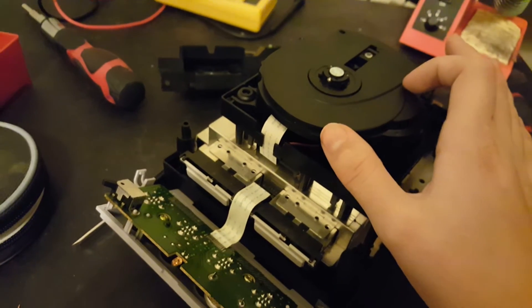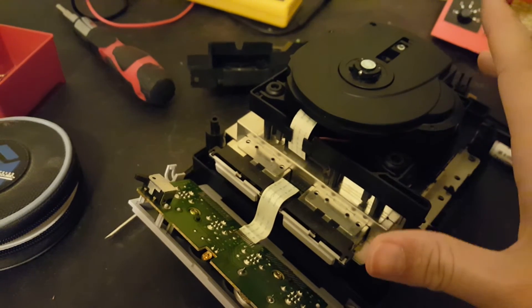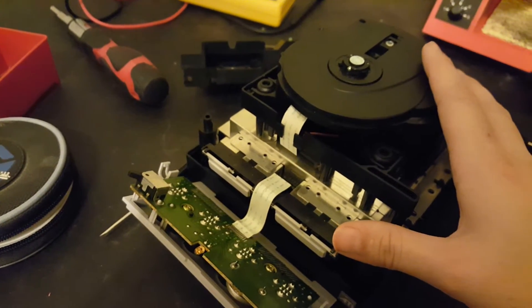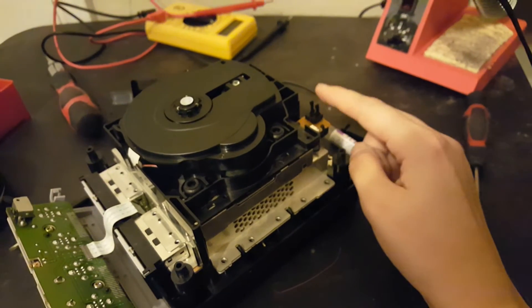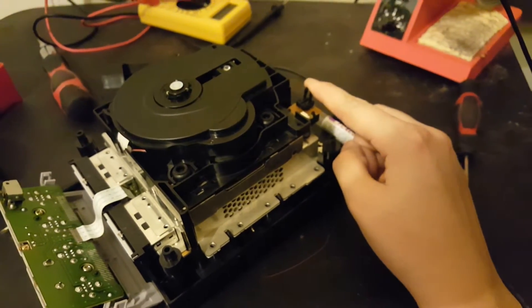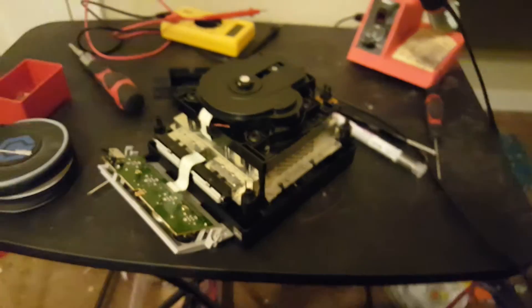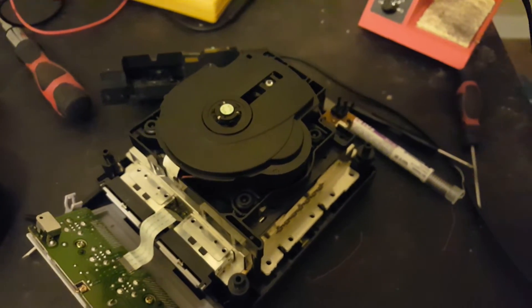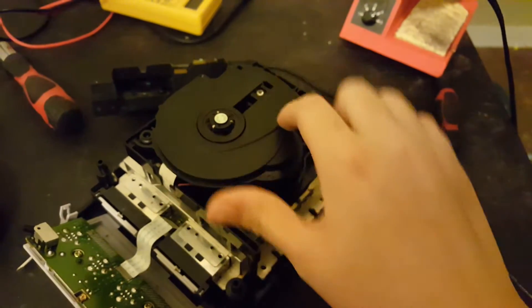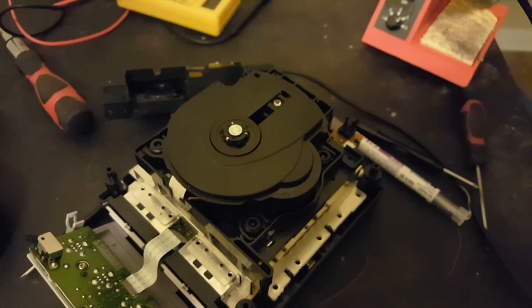I use mini DVDs for mine. It is possible to use full-size DVDs, but the case doesn't fit them. If you want to go that route, you'll either have to leave your GameCube disassembled and wire the lid switch permanently closed — which will prevent you from using multi-disc games like Resident Evil 4 — or pay 70 bucks for a specialty case that fits full-size DVDs. I just recommend getting the smaller ones, the mini DVDs.